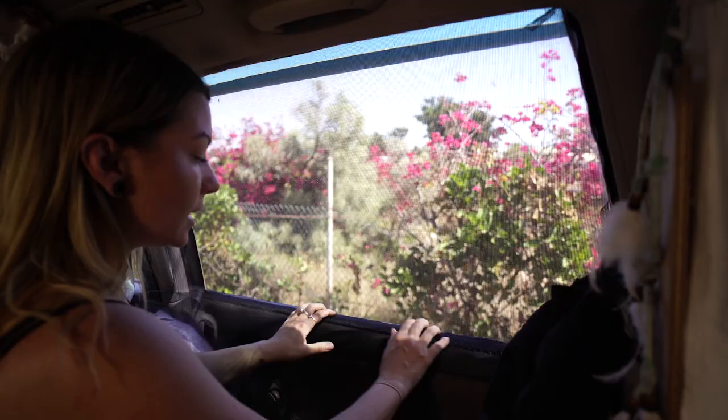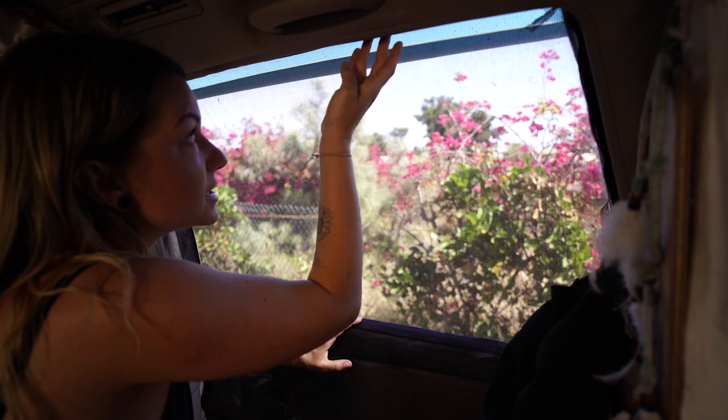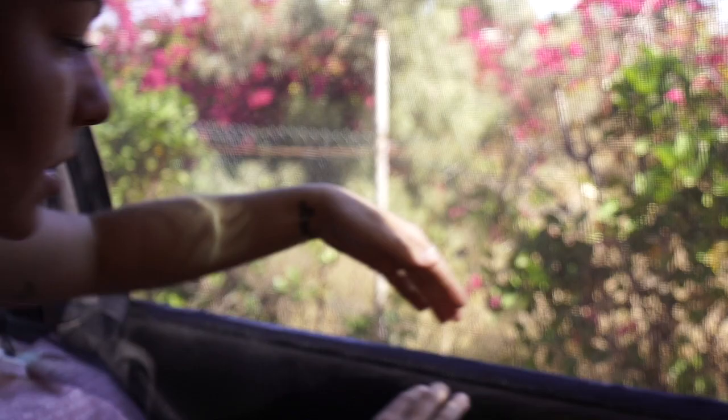So as you do one side, you just got to make sure that the other side is still sitting nicely against that sticky. So this is why you want to make sure that you've got plenty of excess. You're not cutting it off at this stage. Because I just pulled that flat, it just made this pop up a bit. So you just kind of want to make sure you're coming in at the window edge and then flattening it out that way. Because if you go from the other way, it can sort of create that tension.